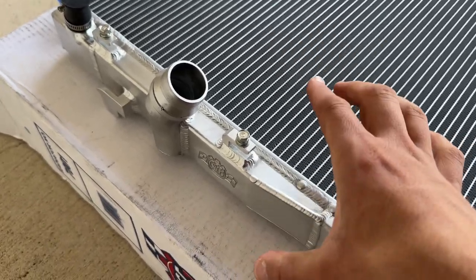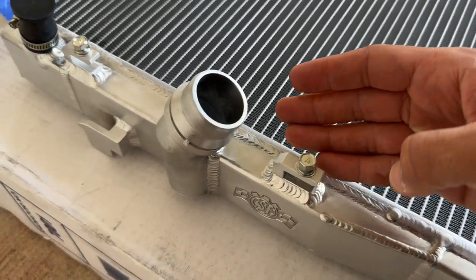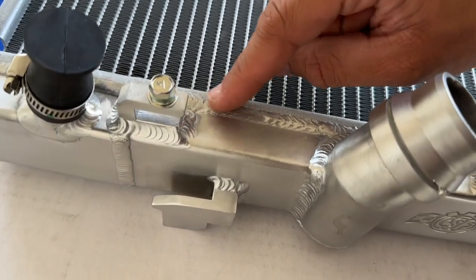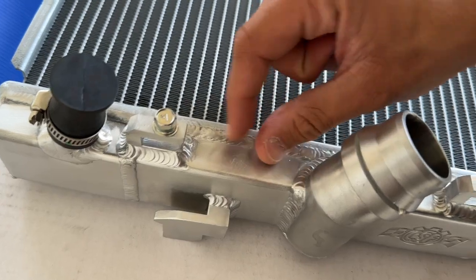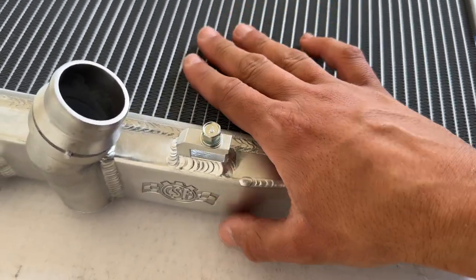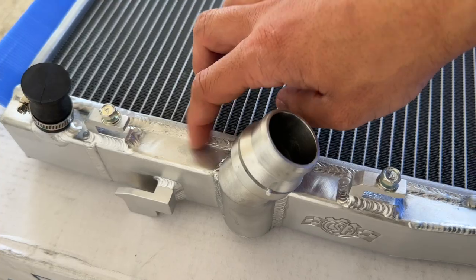Let me explain why you actually need one of these fully aluminum radiators. It's fully metal — no plastic on the sides. This is the most common place an OEM radiator leaks from. The OEM tank is all plastic, and plastic doesn't bond with metal too well. On the new radiator you can see a nice clean weld, whereas on the OEM the only thing holding them together is an adhesive and some plastic clips — overall just a flawed design. Metal on metal will hold up for years, unlike plastic on metal which causes premature wear.